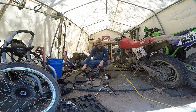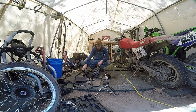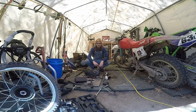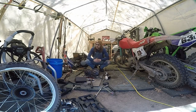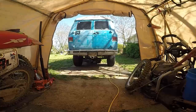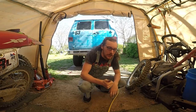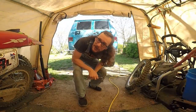Luckily my brother came in with a massive save because him and I recently changed out his carrier in the back of his truck. He had 14 years, he didn't change the gears out, just a carrier. So I grabbed his old carrier for free — thanks man, saved my butt for sure. Going back to the video: what I'm doing is loosening the pinion nut prior to jacking up the truck so it's easier to get off. Never mind, the pinion nut wasn't even tight.